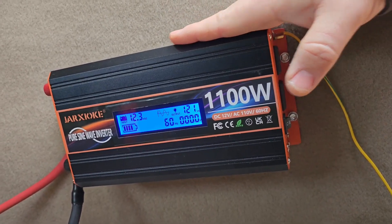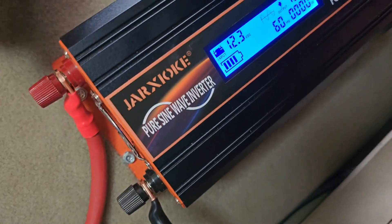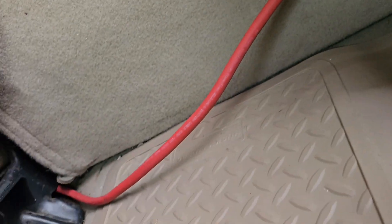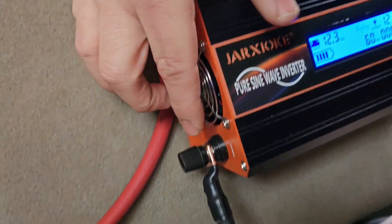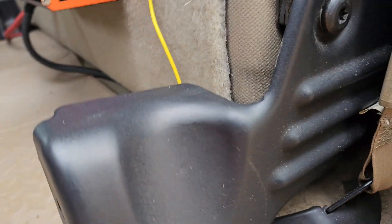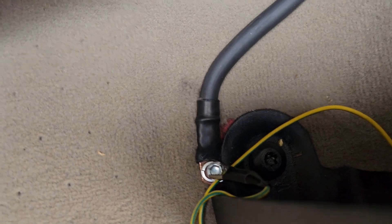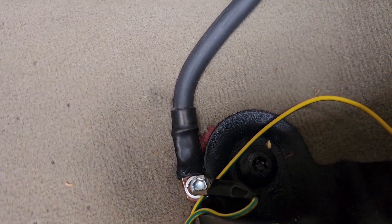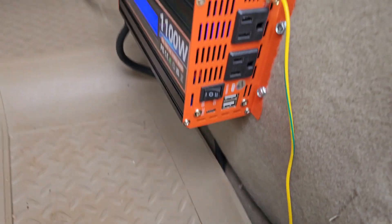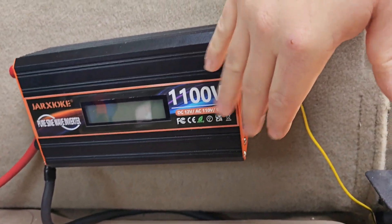This is a $100 unit from Amazon — 1100 watts, pure sine wave inverter. Here are the connections: that wire we ran from the engine bay is your positive, just like that. There's the fan. The ground wire — I ran it over here. You have to have good metal contact, so I sanded off some paint, drilled a hole through the frame, and grounded it right there. There's another wire that says it's a ground but I already grounded through the ground terminal, so I just clamped it there. Not sure if that's correct, but it's working great.